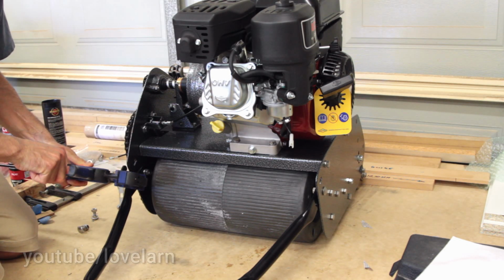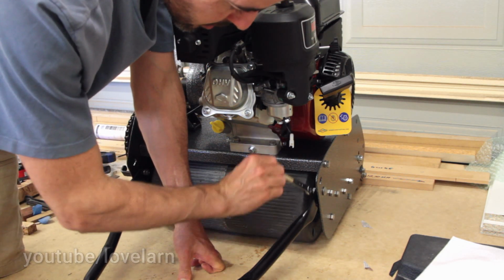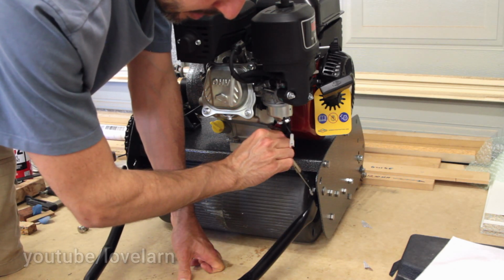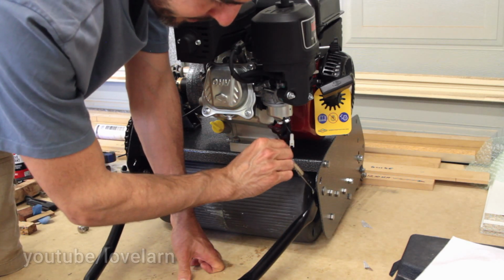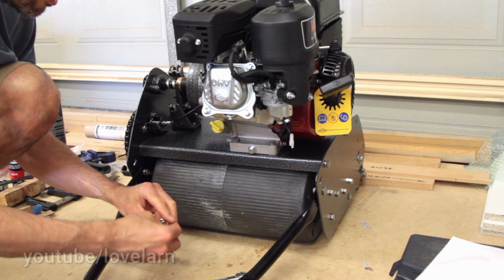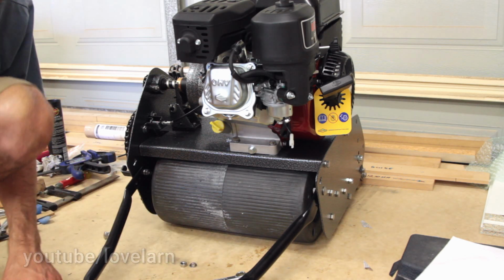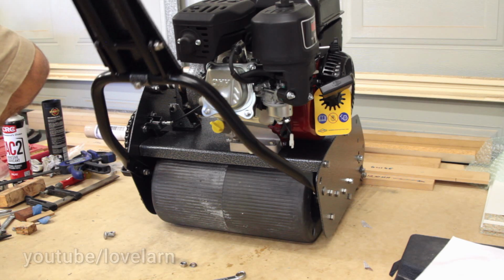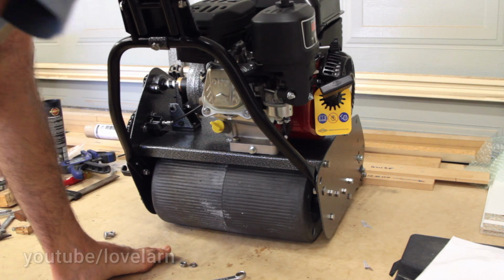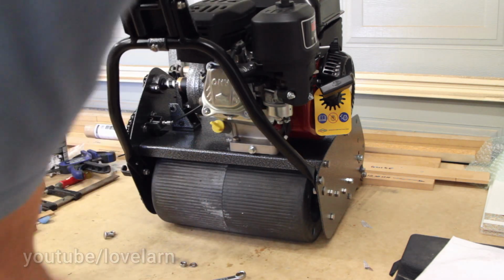I'll let off this clamp. Tighten up on the other side a little bit, just to avoid having to do it later when the other nut is in place as well. And then we can prepare our 2 cup head bolts and pivot these bars up and into place. You can see how the bend with this engine in place kind of gives us a little bit of extra room. There's the muffler down here as well to think about, so that's going to fit through there like so.